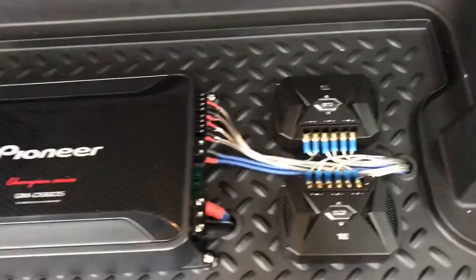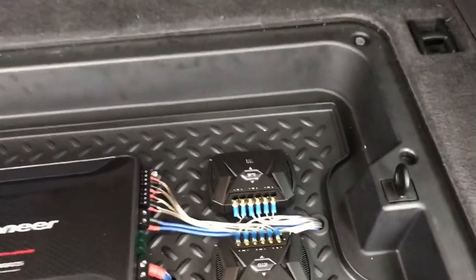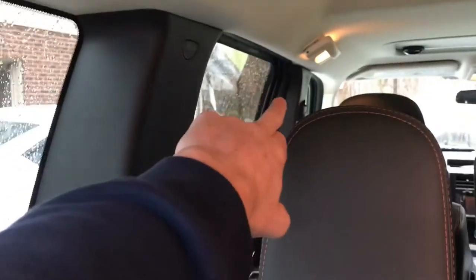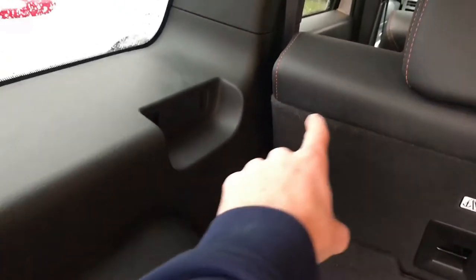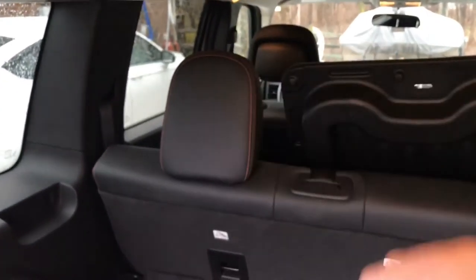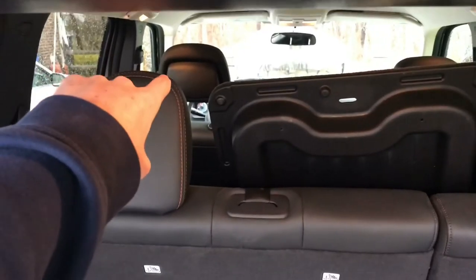All my speaker wires were run all the way up through there besides one — I ran the rear left speaker wire through here, underneath, and then up the pillar back here, then underneath the headliner all the way up to the front pillar and down into the door boot. The reason I ran it up the headliner is so I'm not running it right next to the power wire that also runs down on the ground, and I didn't want to run a wire from back here all the way around the front, across the dash, and then up the pillar — that's just too much wire. It just made it easier to go this way.